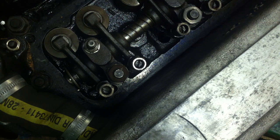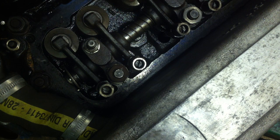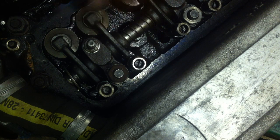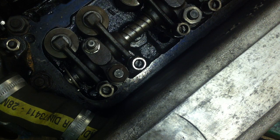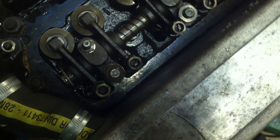And that's how to set the tappets on the 1500 BMC. Some notes: if you've just rebuilt your engine, set all the tappets so that you can get a good click as you wobble them first — do them all loose, but make sure the pushrod can't fall out. Get them all set, then run it for half an hour and let it cool off, because you want the tappets to settle in. If there's any muck in the cups, it's going to mess your numbers up. So let it run to begin with. That's tappets — please subscribe to see more.